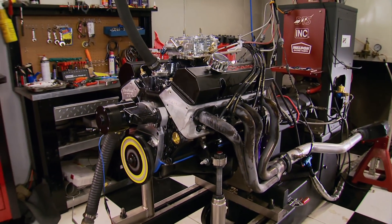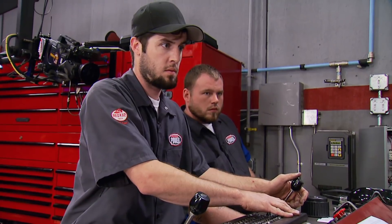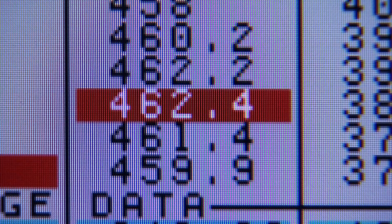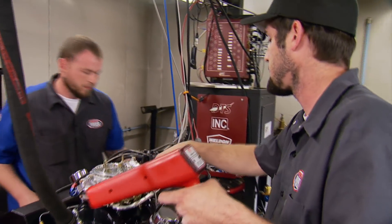Finally we can break it in, bake off some paint, and see what John's expecting. He wants torque to be just as high as horsepower — within 10 to 20 horsepower — and would be stoked at 460 to 470. You can tell by the sound this thing is starving for fuel. We'll up the jets and the squirters. The result: 462 horsepower and 461 torque — right in line together, just like John wanted. We know there's more in here, so we'll try three more degrees of timing.